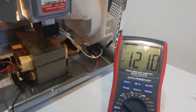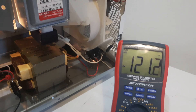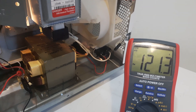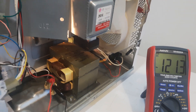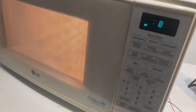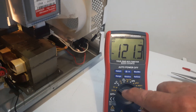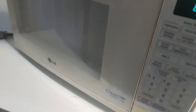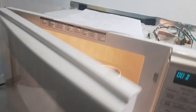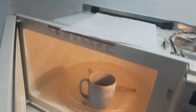Here's your voltage. The voltage now tells me that that relay is good — 110, 120 volts across here. We're just going to wait a second to see if the water heats up. So that's the voltmeter reading. The water's still cold — I can feel the cup is still cold. So that's not the problem; something else is wrong with the microwave.